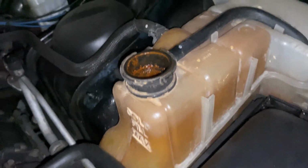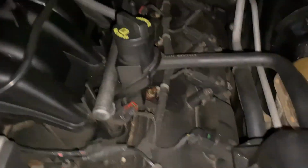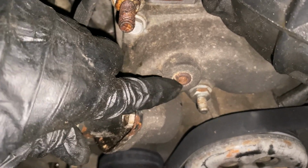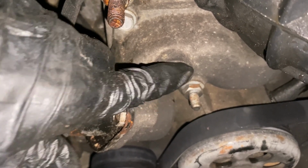I'm going to open up the coolant cap here. I'm going to wipe that because it's kind of gross. And where's the bleeder here? Oh yeah, the bleeder on the Hemis is right here. So it's a hex bit. I'm gonna have to check to see what it is, but we're gonna want to undo that to help bleed this.